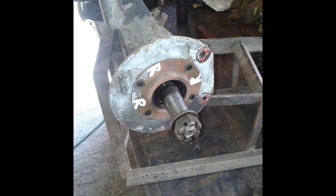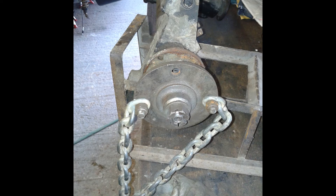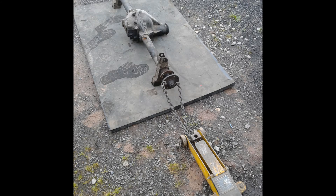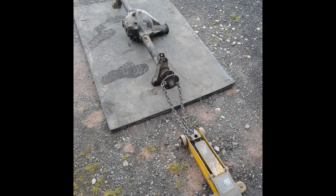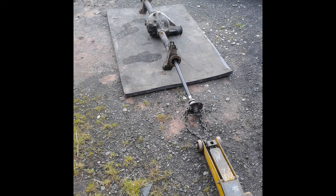Here are the old brake mounts — I've pulled those off. You've got to take the hubs off, which requires some kind of slide hammer arrangement. I used a chain and a heavy jack to pull those off. Then you remove the brake back plate and bearing retainer. Then you put the hub back on and pull again to pull the bearing and the half shaft out.